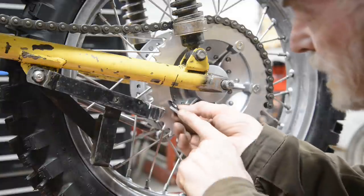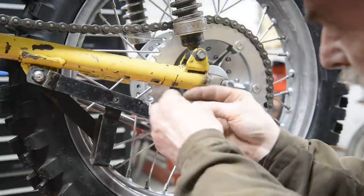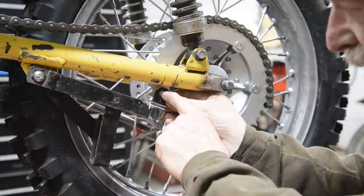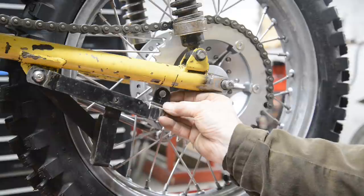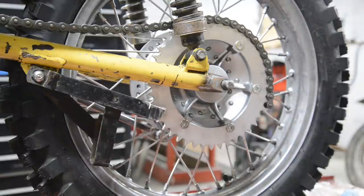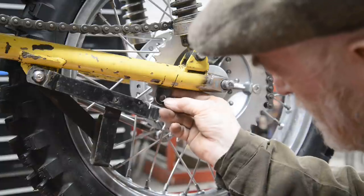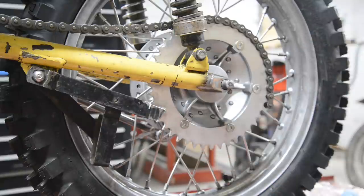So I've drilled a hole in that, and I've chamfered both sides. So that's going to go on there like that. Then, basically, I'll make another one of those for there. Weld this on here, and then I say we can bolt the two pieces together and bronze that in situ, and we know we're going to be all right. So let me go and, let's see how big a piece. Oh, I left my ruler off of there, would you believe? I'll go and get my ruler, I'll measure how big a piece I need for here. Actually, going to be just a little shorter than that. And then we'll make that and get everything welded together.